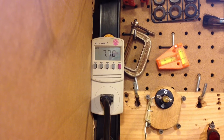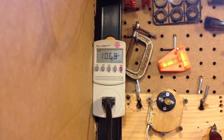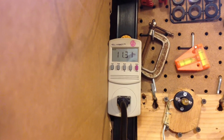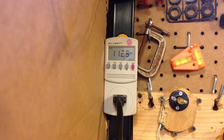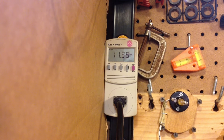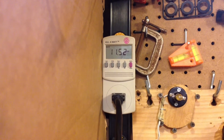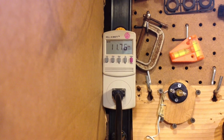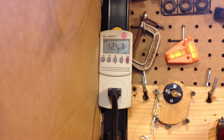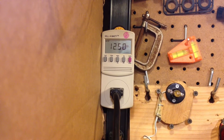With the heater on, the reading is climbing: 4.58, 5.76, 6.38, 7.03, 8.24, 8.84, 9.79, 10.16, 10.50 — going up pretty slowly — reaching 11.11 amps. At this point I've already exceeded the maximum draw on the outlets. With the fan on low the draw is about 11.24 amps, over the limit. Throwing the fan speed up to high, that's pulling 12.4 amps — that's a lot of power.